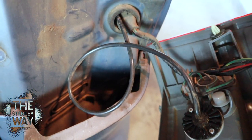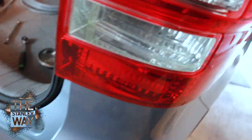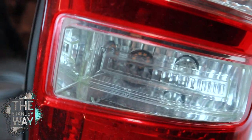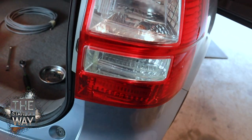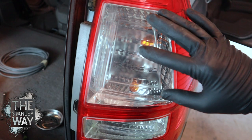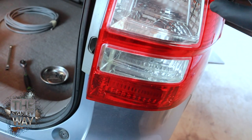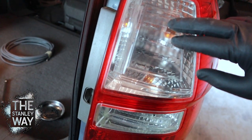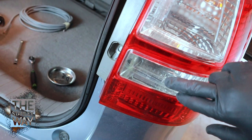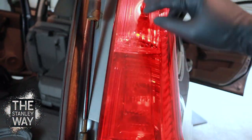The rest of it goes down in there, and if you look around the other side you can see the LED inside there. The reason I did that in the reverse light bezel is because a lot of times when my wife's delivering the mail she'll turn on her hazard lights — that way these will be in addition to the hazard lights. But also when she wants to use the blinker, she'll have the blinker on its own and be able to leave the strobe lights on at the same time.